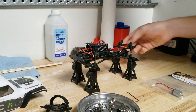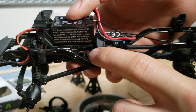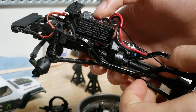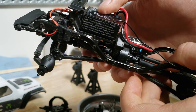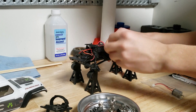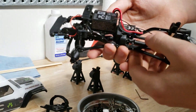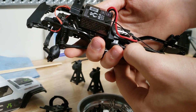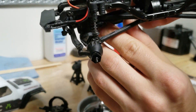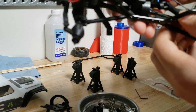Next thing I want to get out of the way is the drive shafts. You can see here there is a screw there and a screw there. All you have to do is turn the drive shaft and get them in the right spot - right there is good. Then we will just take those out and these will come out of the way. With the screws removed, you should just be able to slide right off. Now you can see the drive shafts are hanging down - at least the front one is.